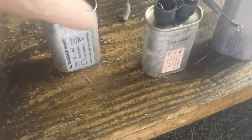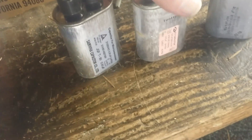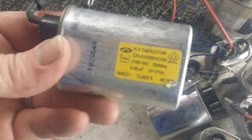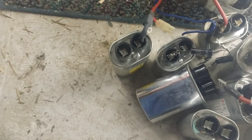Since I've already cannibalized a number of older microwaves, I already have three set aside that we can put in there as long as one of them will fit. Each one of these is 0.91 microfarad, so we'll go ahead and put this one in. Because capacitors aren't all created equal — a lot of them can be anywhere from as low as 0.58 to as much as 1.3 microfarads. So you want to make sure you put another capacitor in there that's matched to your system.